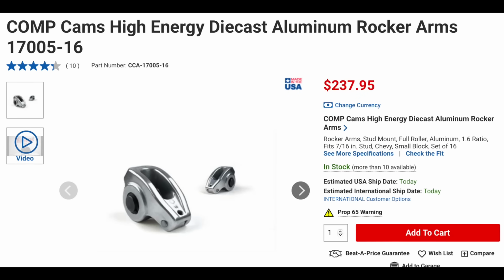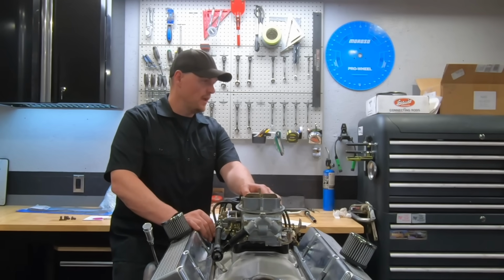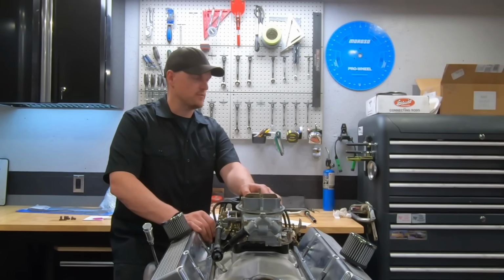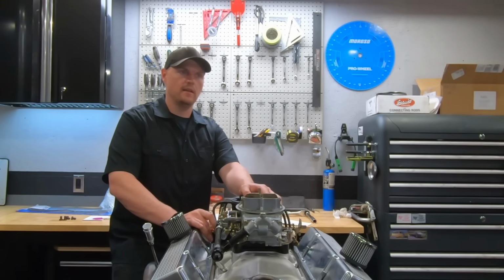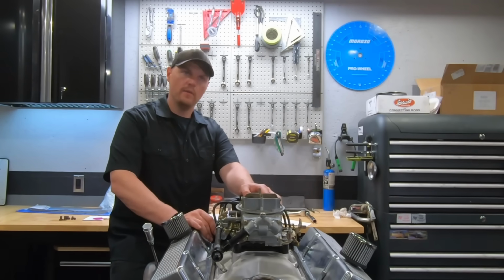I like those rocker arms, made in the USA. The bearings, well, they claim made in the USA. It's actually just the bearings made in the US and the bodies are offshore. The only thing I find with those rocker arms is that no matter what I use them on, they have a bit of a sewing machine sound. I've had subscribers reach out to me about this, and sometimes they don't believe me that it's the rocker arms. They end up swapping them and the noise goes away. It's not really a tick, but more of a sewing machine sound. Every cam, every combination I use those rocker arms on, I've noticed it.